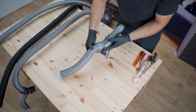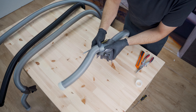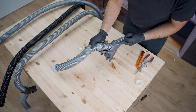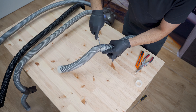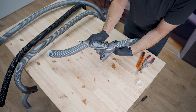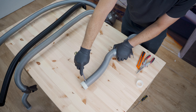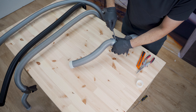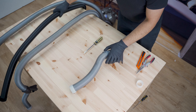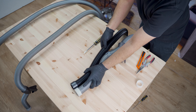As you can see, you want to just leave this off. If you have a look, you have a beveled edge on one side — this goes frontwards. So the round circle goes towards the machine and the beveled edge goes towards the handle of the hose. Just make a point of that, and also make a point of how long the distance is between where you're going to put this and the length of the hose, because that's what's going to matter when you put it back onto the machine. Make sure you put it into the same position, about there.